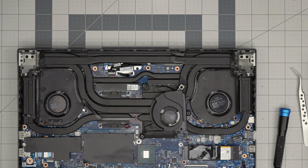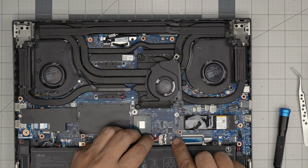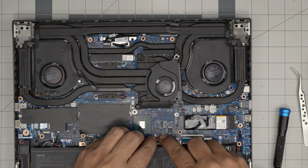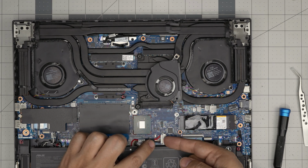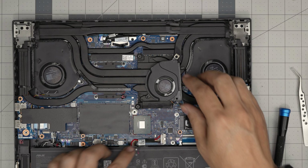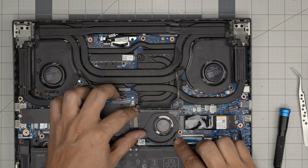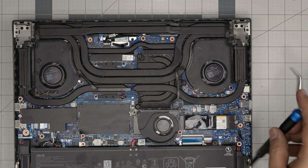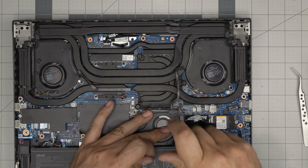Bring the connector for the battery. Align it. Make sure this metal bracket is back. Align it and push it towards the motherboard. Push the corners down and slide this metal over. It should come about 0.5 millimeter over. And that's when you want to grab this fan. Make sure the screw holes are aligned. Put only 2 screws because it only takes 2 screws from inside.